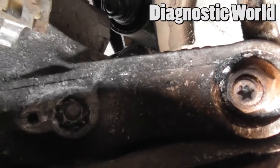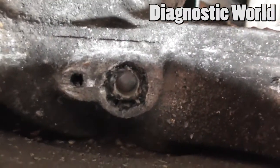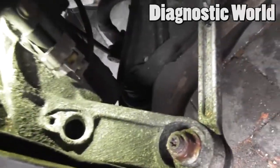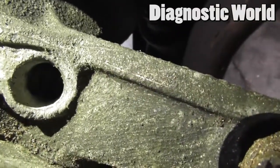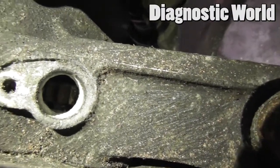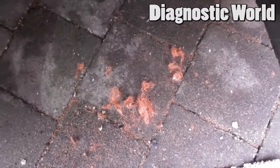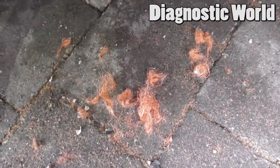The plastic surrounds were still stuck in there, so I needed to scoop those out as well. You can see the sensor hole is now completely cleared — if I shine the light down there you can see the reluctor ring right through the hole. Here's all the debris I managed to scoop out: bits of plastic, filings, and that's just half of it.